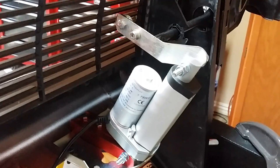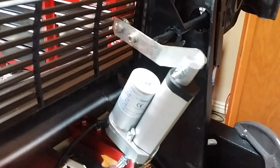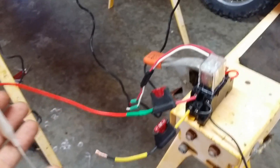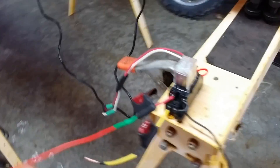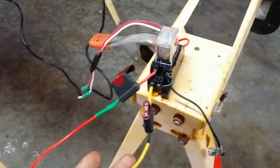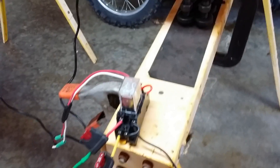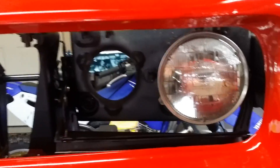Using self-limiting linear actuators, which shut off power once they reach their max limit, and a DPDT relay system that reverses polarity. Basically you've got power coming in — this is to the battery all the time — telling the actuators that they're going to be sucked in. And you've got your input wire, which is charged once the headlights turn on, telling them to extend and open the hideaways.